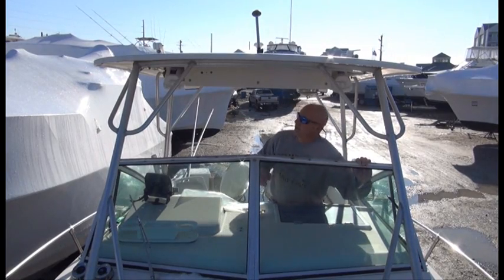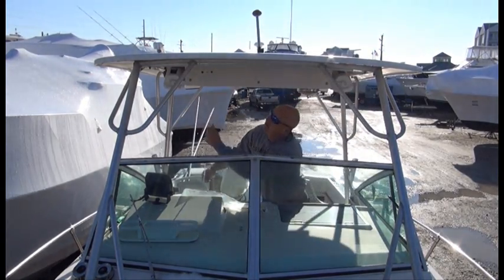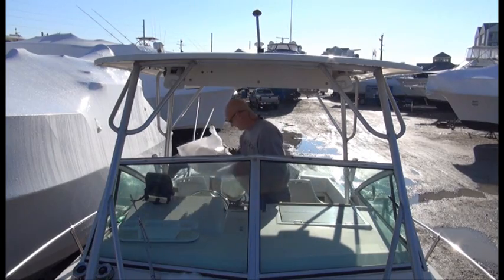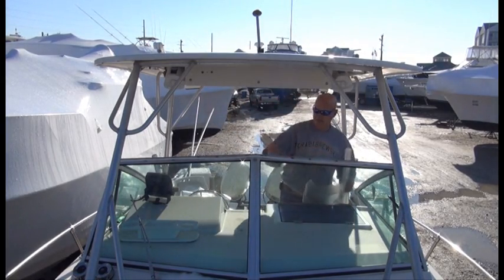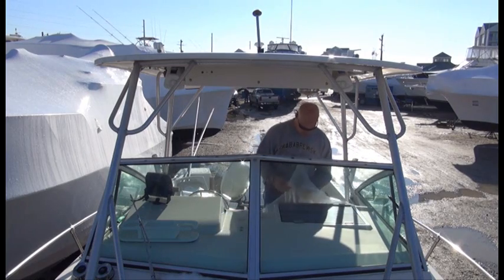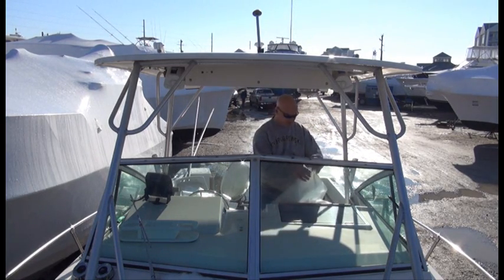All right, we'll start with the front curtain. So we'll peel our transfer tape off the awning rail up here at the top. Now I've pre-cut this plastic. It was about 6 foot by 30 inches. Same thing with the two sides. I just pre-cut out enough there to make it. So I'm gonna find the center of this piece.